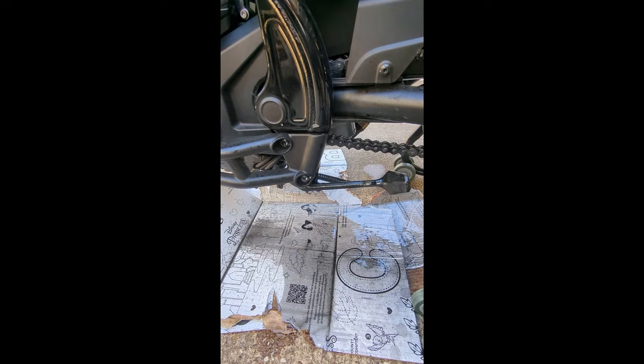And remember to clean your brush because you have that brake cleaner on it. So I basically clean off the brush. Now my brush is completely clean, and I basically just go through, and as I'm rotating it, I'm also cleaning it. And I do 2 rotations of this as well. That's it. So now we've got the brake cleaner cleaned off the chain. Then we've got the WD-40 that pulled off all the brake cleaner film. And now we'll use the gear oil and just coat the chain with gear oil.